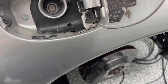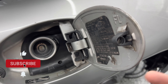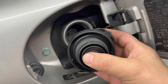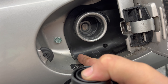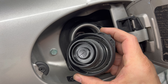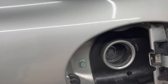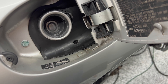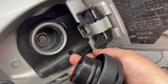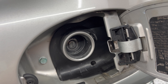As part of getting the car restored, I need a new gas cap. The one that came with it was damaged — my friend Bruce, Texas Squirrel, gave me one a couple of years ago, but I'm still getting a check engine light about a fuel vent. I've got a new fuel vent solenoid valve here underneath this towel. However, the gas cap could also be a culprit — you can see the seal is cracked pretty good. So I went ahead and got a new OEM one from Porsche; it came with a tether that goes right here at the bottom, using an expansion rivet.